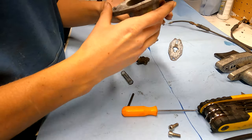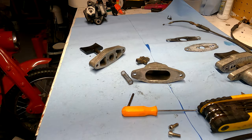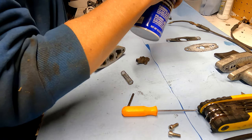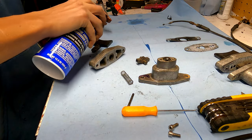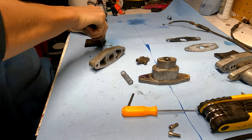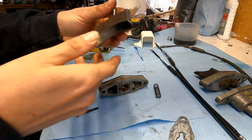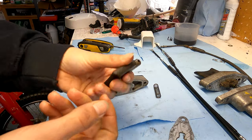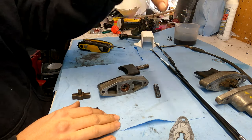This all looks pretty clean — this thing was recently rebuilt so everything is in good shape. We're going to clean anything off with a little bit of carb cleaner, just a quick spray down, and then clean the power valve off with it and scrub it with a brush. This is about how clean I get my power valves — you can get them cleaner, it's up to you. This normally works for me — just getting the big build-up of carbon off of it. Now we'll reassemble this one and then do the same to the other one.